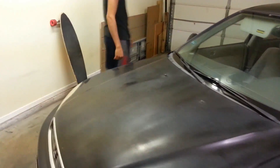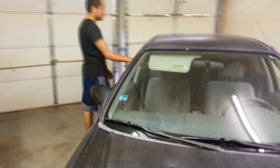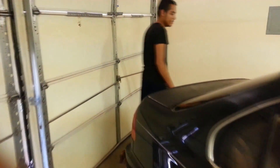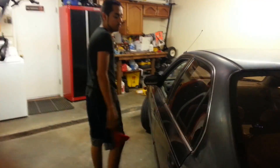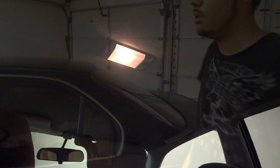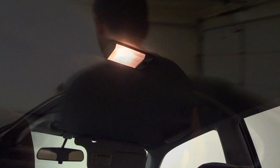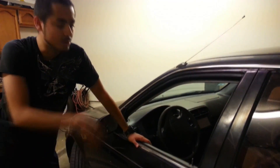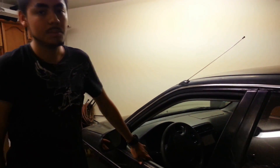After further investigation, I've come to realize that my dome light is staying on. I checked all the doors - all the doors are closed. But the dome light stays on no matter what. So with all the doors closed, it's still on. I knew it was coming because the switch in there is broken. If I flip it off, it stops drawing current from the fuse.